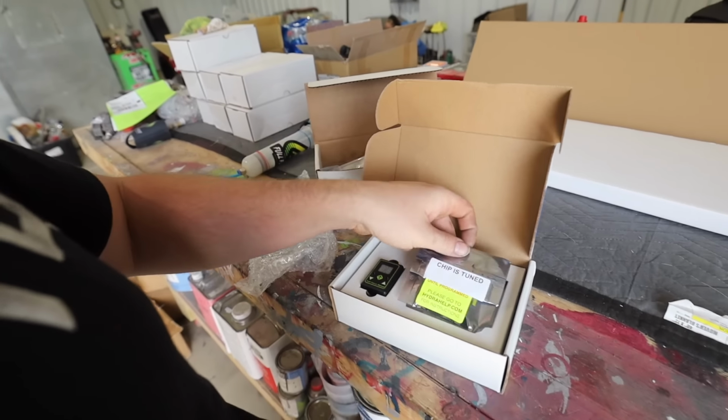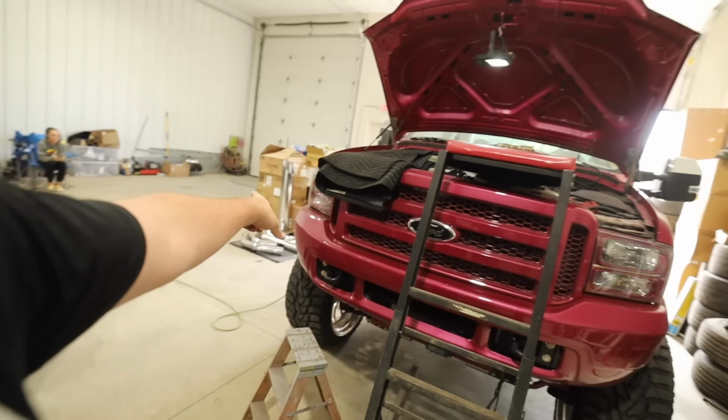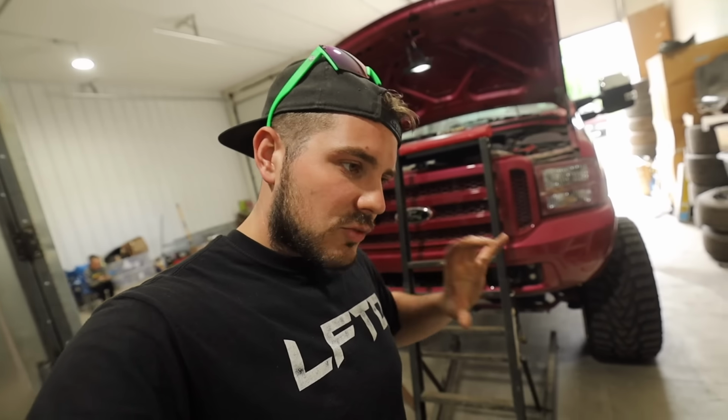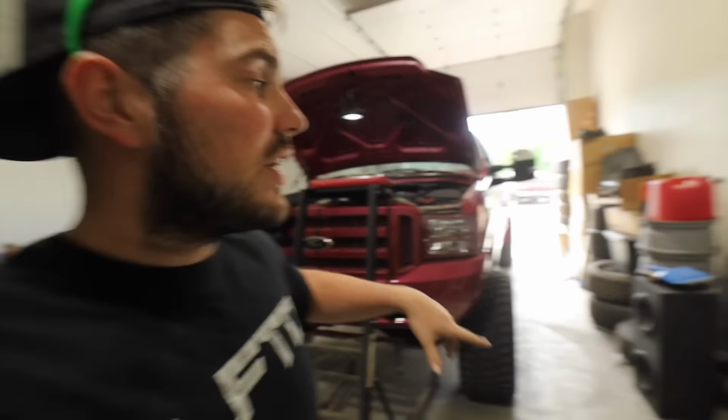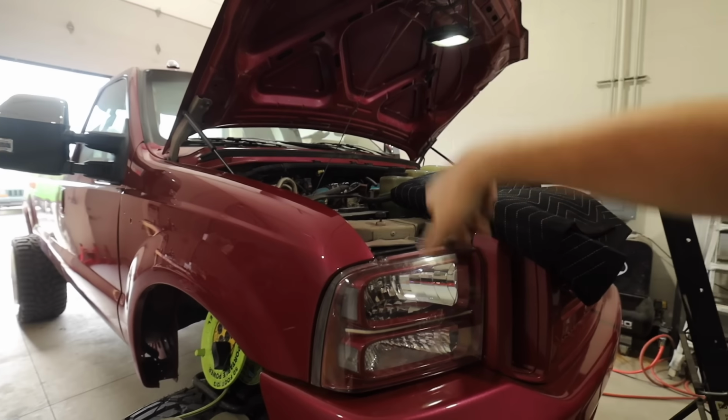That ain't anything really. And then obviously, because these are stage 2 injectors, this thing is gonna have a lot of fuel. So my goal is to do the injectors and attach this exhaust. Now, because I don't really want to start this thing up, especially at how long this thing's going to have to crank to fire, I don't want to do that where the exhaust is hammering right into the firewall. So I think getting the exhaust installed is definitely on the list before we even fire this unit.